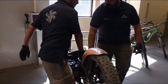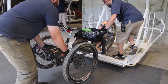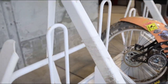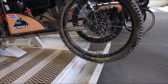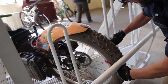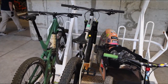Remembering your recommended handholds, grab the Bowhead and transport it to the bike carrier. When setting the Bowhead on a rack it's best to go rear tire first since the front tires will not fit between the wheel stands. On most carriers it will be a tight fit, but at a slight angle the bike will just fit on the carrier. To ensure the bike does not fall off in transit, it is best to strap the rear tire to the back of the carrier. A simple bungee or elastic strap is enough to do the job. While the resort should provide straps, it is best practice for the rider to carry their own to ensure availability. Also note that most carriers are large enough that you can still fit a regular mountain bike in the available remaining wheel stands.